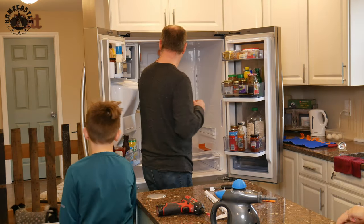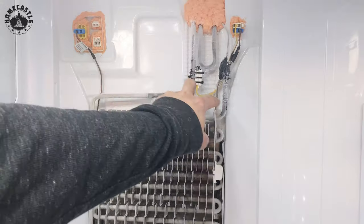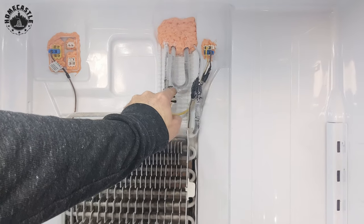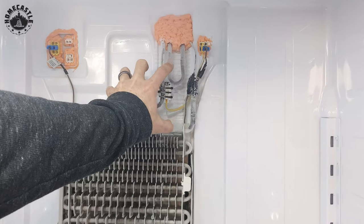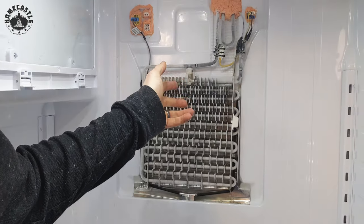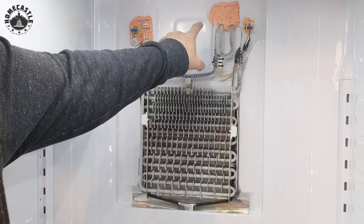This is exactly what you want to see — a properly functioning coil. There should be a uniform layer of frost over everything and not a giant block of ice. When this freezes up, the entire coil turns into a block of ice, and as the ice creeps into the fan region it encroaches on the fan blades. Once the fan can no longer spin and circulate air, even though it's frozen solid, the refrigerator temperature climbs to 40 or 50 degrees — that's when you know you have a problem. Symptom one: ice gets close to the blades and you hear ting-ting-ting.